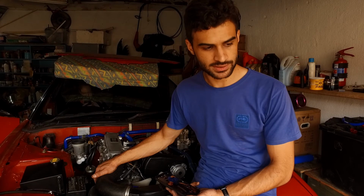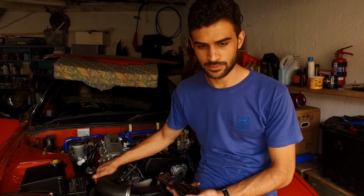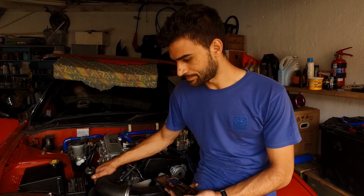I was putting the bumper on, as you guys saw, and then I decided against that for multiple reasons. The bumper is slightly warped. The frame is still skew, which means we're gonna have to take the bumper off in any case. Now the only thing is we can't really drive the car without the bumper, but I don't know. I'm gonna figure out what I'm gonna do. Might just be on the next time we start the videos. Everything does not line up, because when you try and put things back on in the correct mounting holes, the mounting holes aren't in the right place, right? So let's hope this car can go to the body shop anytime soon.